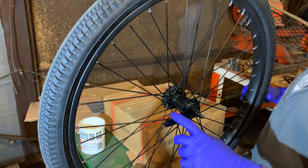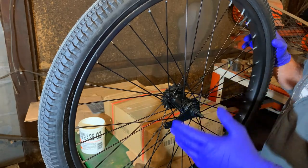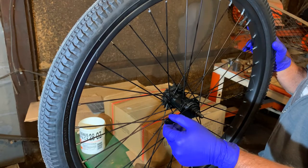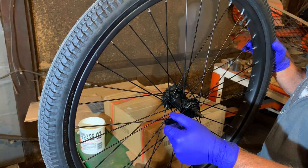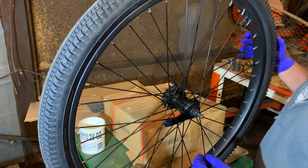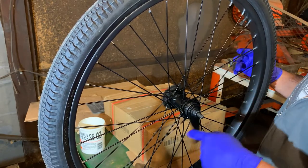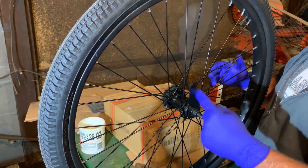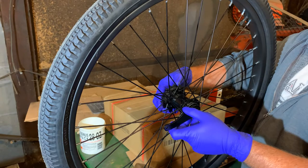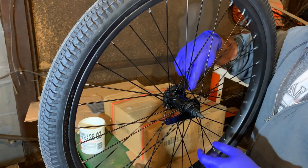Okay, when you're riding down the street — I have the wheel chucked up here in the vice so I can't spin the wheel and hold the axle at the same time, so bear with me for the general operations. Usually this is hooked to your frame, and that's what allows the brake shoes to open up when you pedal backwards. So we're rolling down the street, and now we need to stop the bike — this would usually be hooked to the frame. You pedal backwards; the harder you apply pressure pedaling backwards, the quicker the bike stops. What is going on inside your hub?